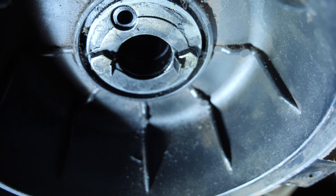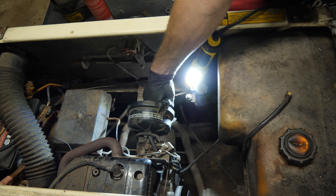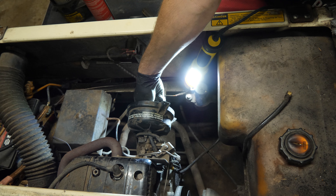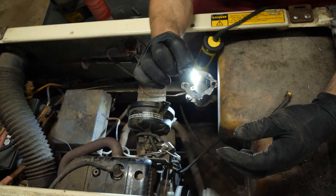There we go. Now we can get our 10mm on there. EasyGo uses a similar type of setup on the fan on the inside of the motor for the Robin engines. There's six 10mm bolts that hold the fan to the flywheel, and it has a very similar arrangement where they have those little safety tabs. Here's what they look like — basically just a couple of tabs, you pull them away and then you can get the socket on. And then you have this plate which goes on in a certain direction — it only goes on one way because you have the breather port. You have to watch out for that.